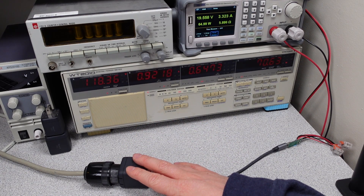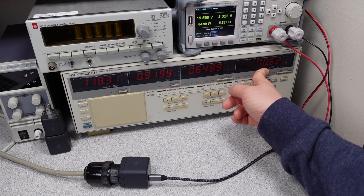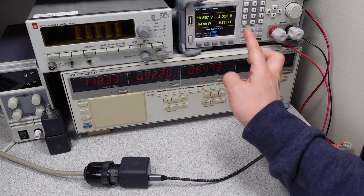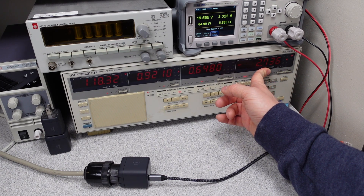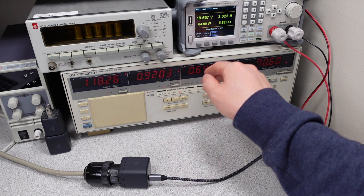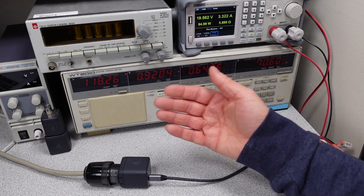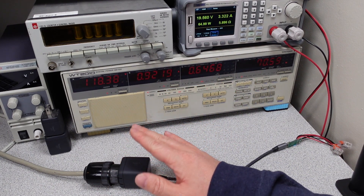Here I have the device running at its full rated load of 65 watts, and we see it's using about 70 watts off the wall, so it's pretty efficient — around 92%, which is among the class leaders for efficiency. But this is what we don't like to see: very high peak amps, meaning it's using a lot of current to do this work. That number shouldn't be that high for 65 watts out, but because of the low power factor it's not as efficient at using the AC power. That's just a side effect of power adapters of this type and style.